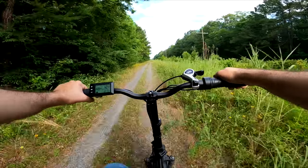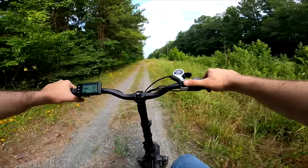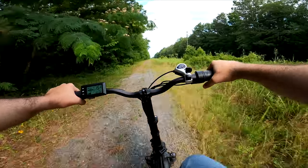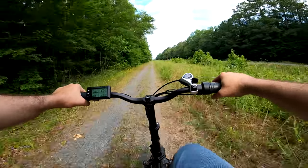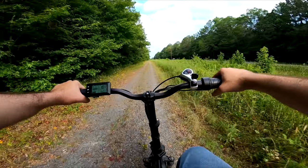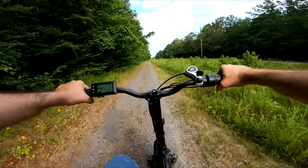While in your desired pedal assist level, spin the pedals without applying any pressure, essentially letting the motor do all the work, take your readings, and then begin applying pressure to the pedals as you normally would, take your new readings, subtract, and there you go. You have the amount of watts you're giving to the bike as well. Is it useful? Probably not. Is it entertaining? Definitely.